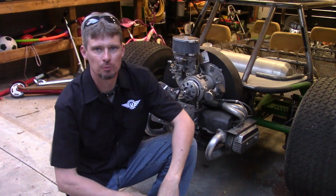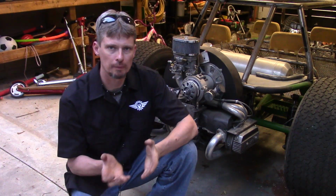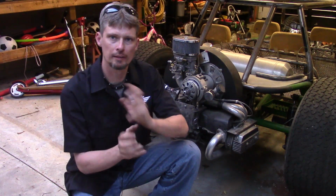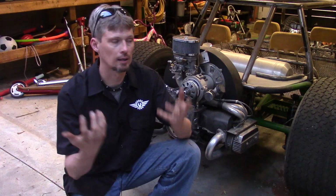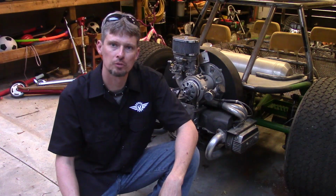Alright, so now you've had the chance to watch the video and you saw me take that handle assembly out of the truck. Just take your time to make sure you don't scratch the paint. If you need to put some tape around the opening, so be it, whatever you need to do, because sometimes it feels like the handle just falls out. Other times it feels like you have to tweak it, try to get it in here, hold it the right way. Some days it's a little difficult getting back in, other days it wants to fall out. It's just the way it is. So just take your time, follow the steps, you shouldn't have any problems.